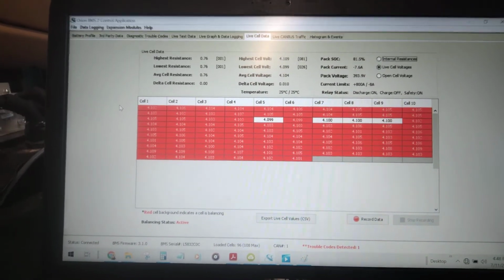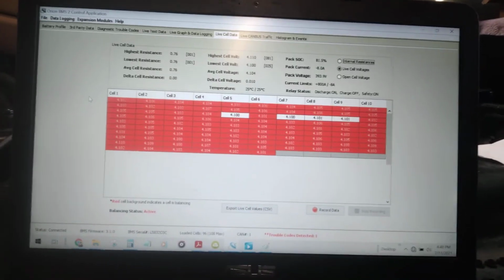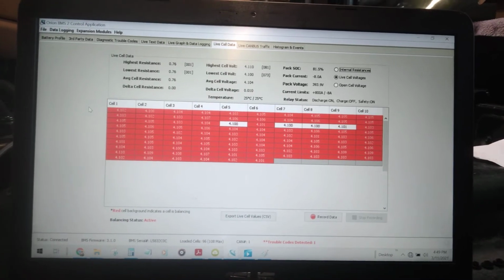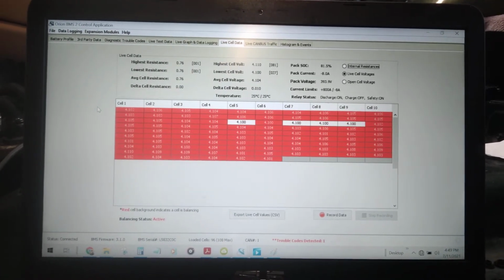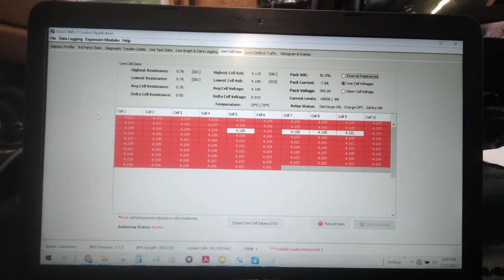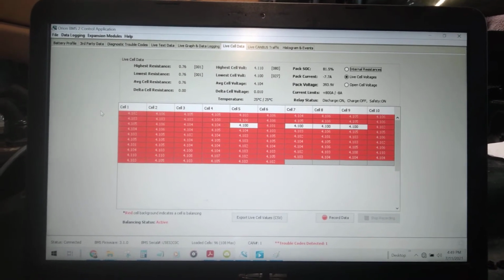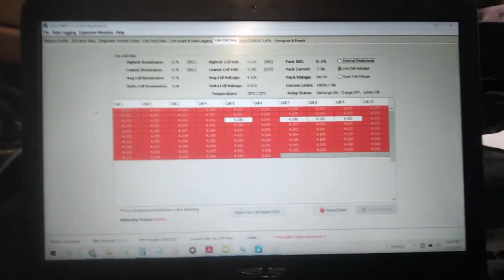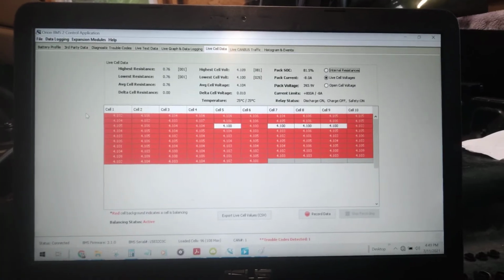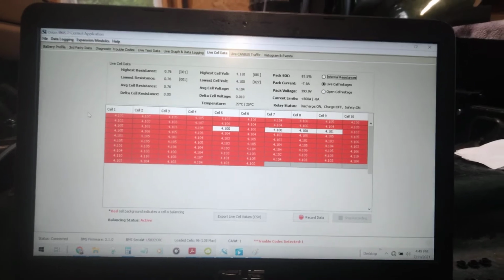So the Stealth EV charger talks to the EVSE on your wall and asks it, how big are you? And the EVSE says, I'm 20 amps. And the Stealth charger goes, all right, then we're just going to charge at 3.3 kilowatts. I've got another EVSE on the house, and it's a 40 amp. So I'm thinking, and I hope that I'm right, that when I plug this Jeep into that EVSE, it'll charge at the full 6.6, which is kind of cool because I have a battery backup in my house and solar panels. And if I am fully off grid, I have a way to change it from off grid to on grid.